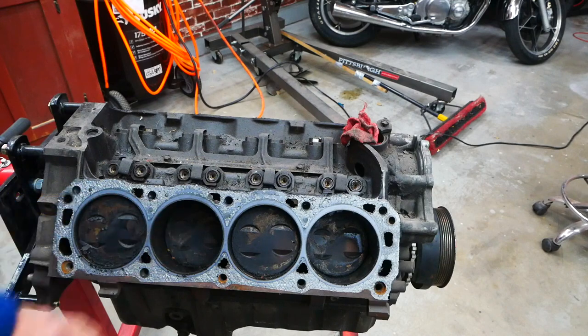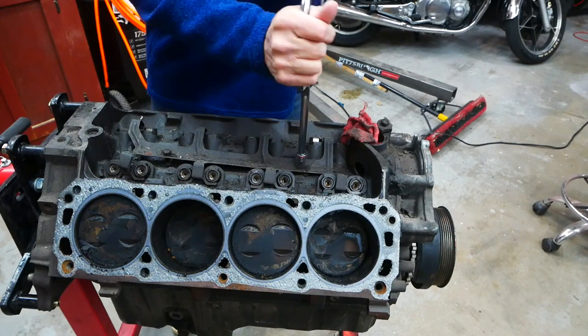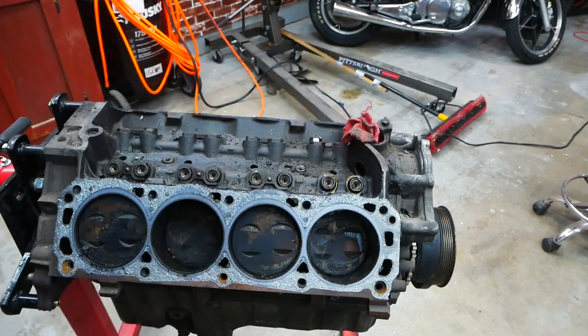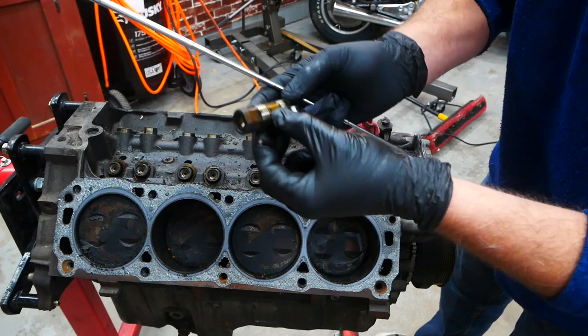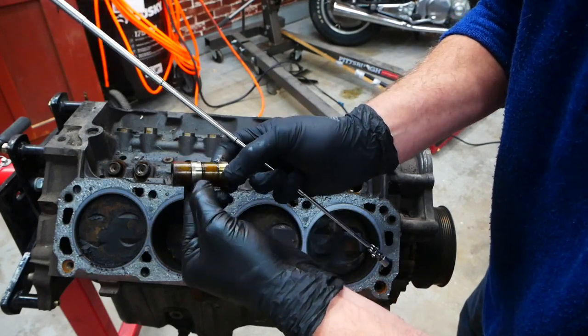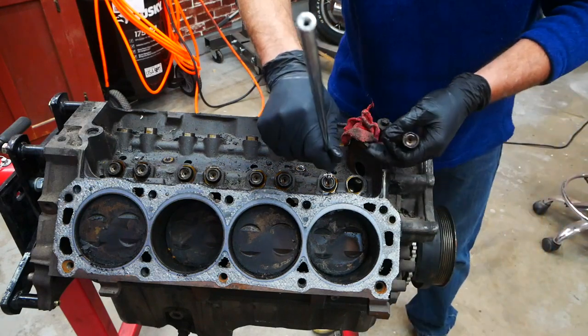I did a preliminary check of the bore and we're slightly out of a four-inch bore — we're at about a 4.002 bore right now. I'll check every cylinder once we get it fully out. The dog bones — the recess goes down. I'll put these in the same bags as the rest of the valve train. These actually have a little bit of wear on them — there's some scarring. If anybody knows if that's a big deal, let me know. We'll pull these intake and exhaust, mark them, and put them in the bags.